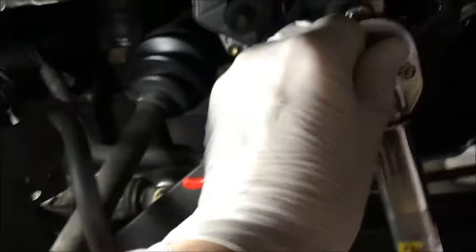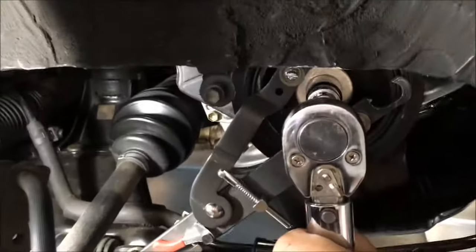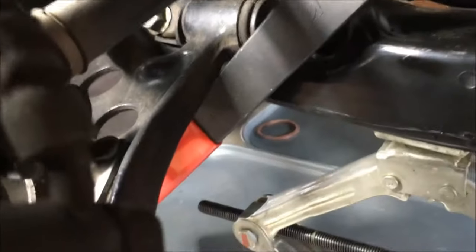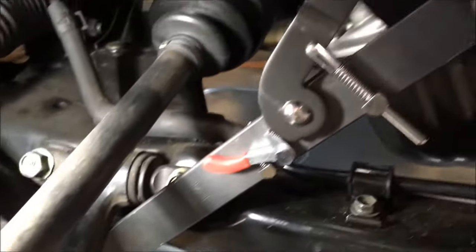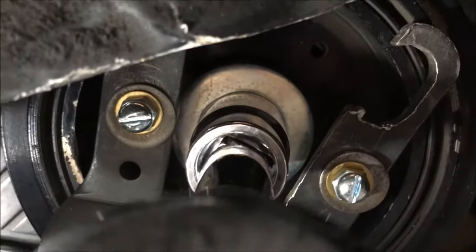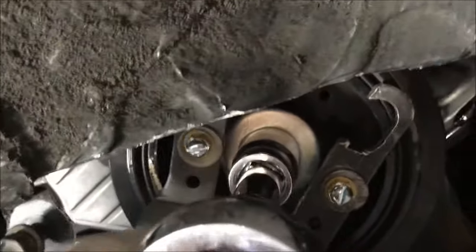Sister's going to be turning the torque wrench and wedging that handle up against the lower control arm. Now we're going to torque that to 80 foot-pounds — the handle's wedged up against the lower control arm. Torqued to 80 foot-pounds. Handle wedged against the lower control arm right there, stopping it from turning clockwise. You can see how the bolts are in there, wedged up.